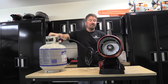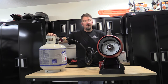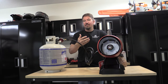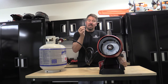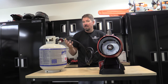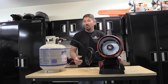If you want to turn this back on, hit your switch on and you're going to have that ticking again. Turn your fuel on, push and hold the igniter, and since it's warm we won't have to hold it that long and that clicking will go away. That's the ignition going in there to make sure you're burning all the fuel. You cannot run this without power — you can't run it without some sort of power, just the heater and propane — not possible. It has an electronic ignition and it needs the fan to push out the air so everything works properly.